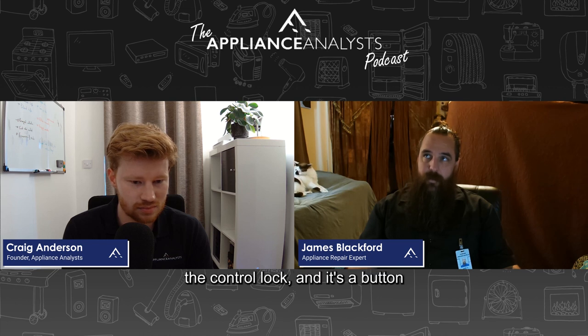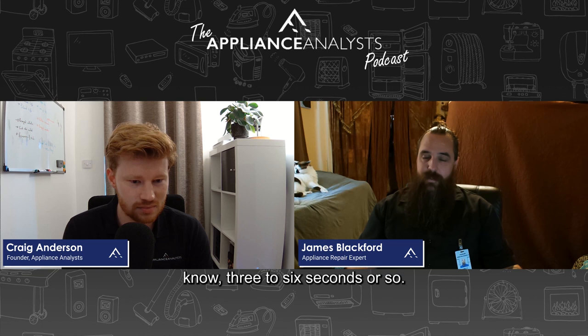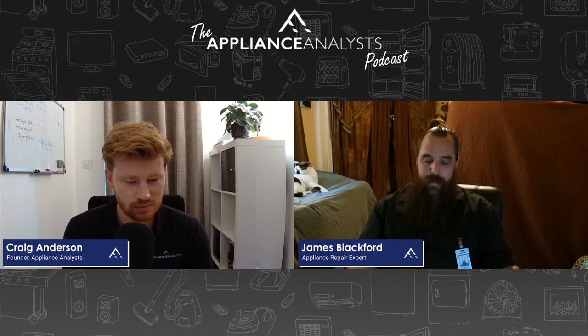Definitely check that. Most dishwashers do indicate on the button panel which is the child or the control lock, and it's a button you typically have to press for 3 to 6 seconds or so. So try that first.